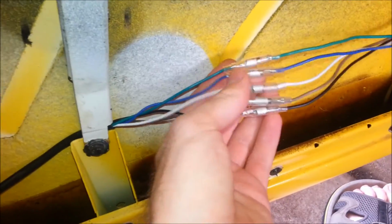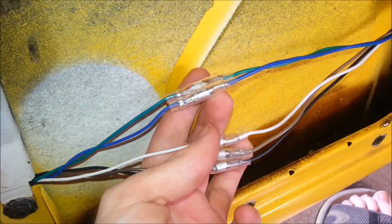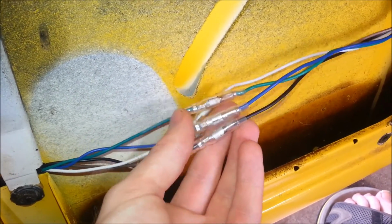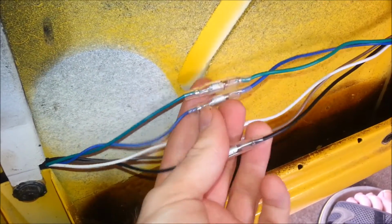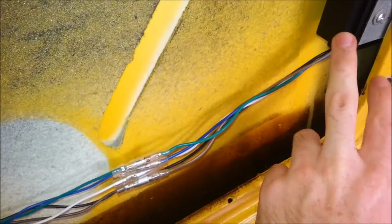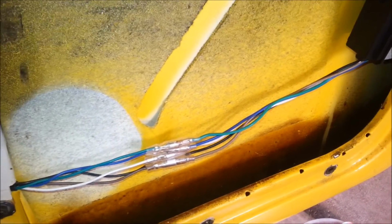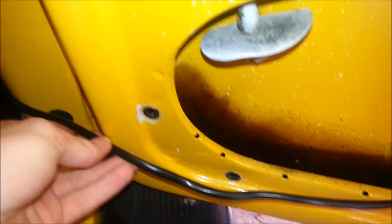One thing to note is that one of the motors, or maybe two, some do it for the passenger side as well, will have 5 wires, the other will just have 2. Or maybe 3 on the others, but from memory I think it was just 2. Anyway, you want to connect the 5-wire one up into the driver's door, because that's the master control, or if you have 2 of those and you want to connect one into the passenger door, you can do that as well. But certainly there needs to be one on the driver's door. And then just run your wires sort of neatly. I need to fix mine up.